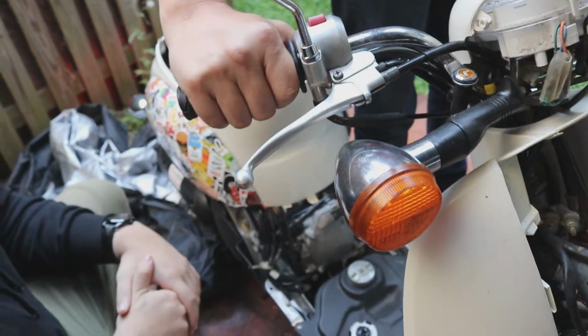Oh, that sounded promising. So for a little while, this here scooter has not been functional because we just couldn't figure out for the life of us why it wouldn't start. It turns out that it had its own built-in safety switch, so when something wasn't plugged in all the way, it would stop working. And that being our fuel pump that we replaced. So now we're trying to see if it'll start so we can at least try to ride it around the neighborhood like a bunch of idiots. This should be fun if it works.